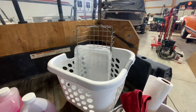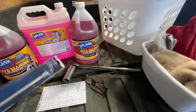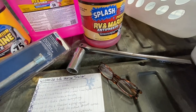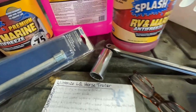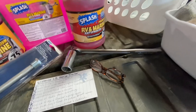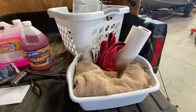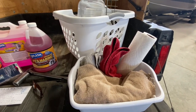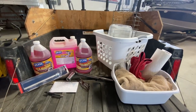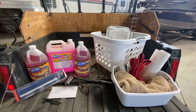I've got some baskets here for hauling stuff from the horse trailer into the house for the winter. I've got the right size deep socket for my anode — it happens to need a one and one sixteenth socket. I have my reader glasses. I am of that age. And then some old towels and paper towels, since some of this can dribble or drip, and especially taking the anode out of the water heater, the water that's in it is going to come flowing out with lots of little chunks and junk. So I want to be sure that I can clean stuff up.